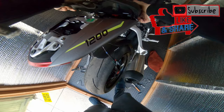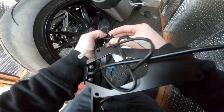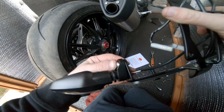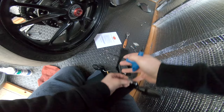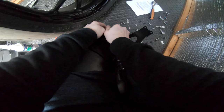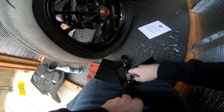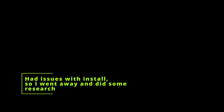Take that seat off. What we do is we use two of these - one goes in there to fit the indicators back up. We use one of the screws and then an eyelet washer. That's a 10mm so it's a 4mm allen key, same for the other side. Line it up - there we go. I will ACF coat these afterwards, and then we're just going to nip them up, just hand tight.